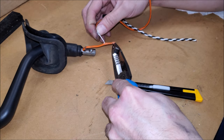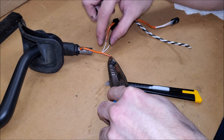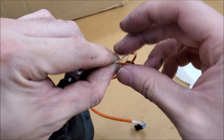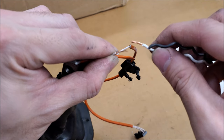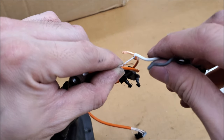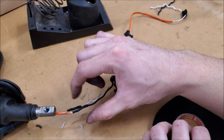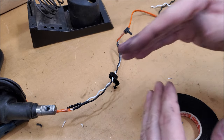The sheath is pretty tough, but you can get it open. We're going to cut back our wire where it's good and then insert our new wire. Upon further inspection with the insulation off, it is multi-strand but it's very thin and weak. This is 18 gauge for me — you can see how much more thick it is. You could put a 20 gauge onto this, but because I have room to maneuver, I'm going to go with the 18 gauge and get a little more durability. This is the first stage of our repair — I have the wire extended, I have it soldered, and I have it shrink-wrapped. I'm using shrink tubing with glue inside: it's going to help insulate it and the glue helps hold the connection together as well.